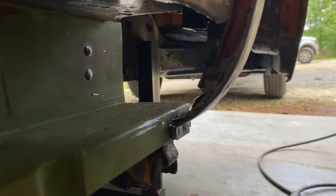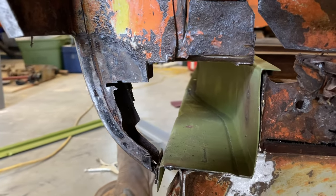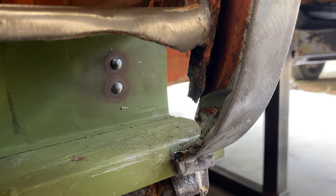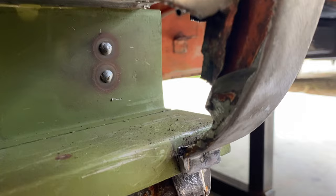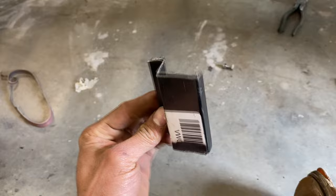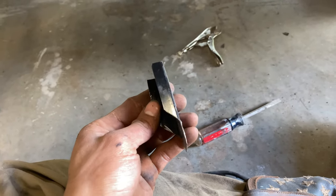One of the first things that had to be dealt with was the inner B pillar. As with the other side of the bus, it was completely rotten. Thankfully the outer skin here was in a lot better condition so I was able to save it. But I did the same thing that I did on the driver's side and used the leftover outer B post skin in order to fabricate an inner B pillar.